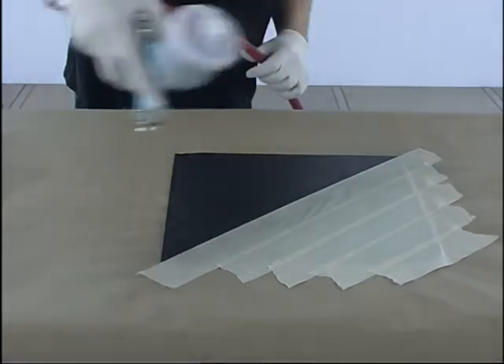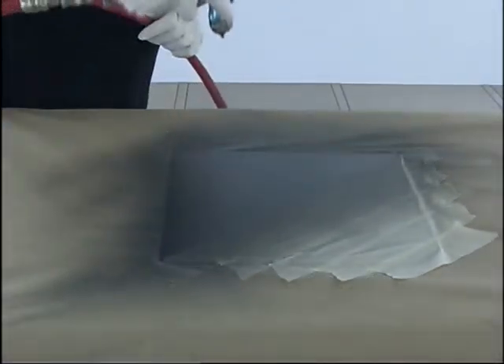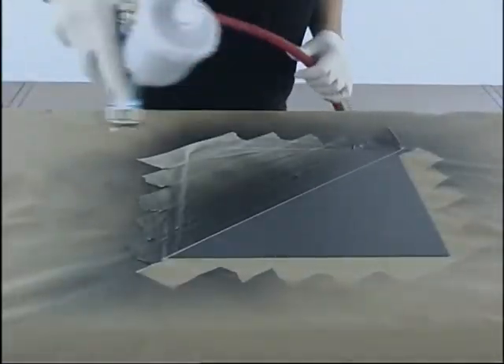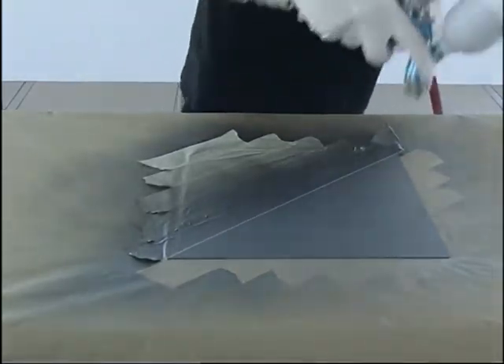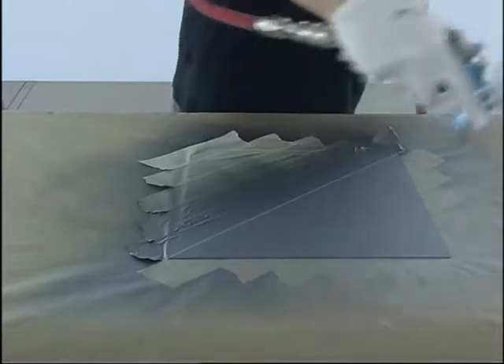What I'm doing now is spraying Pearl Black, using black as a base coat. With two or three light coats, by doing it this way I can get coverage to reach my sealing coat much faster. Now I'm coming in with Pearl Silver and shooting it over my Base Coat Sealer Grey mix. This is the quickest way to get coverage with the pearls and the metallics.